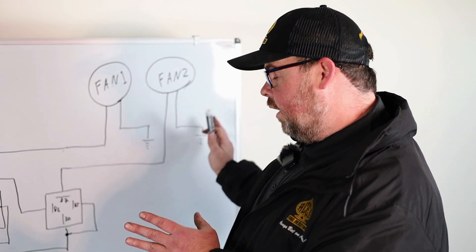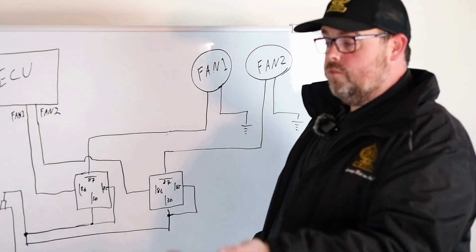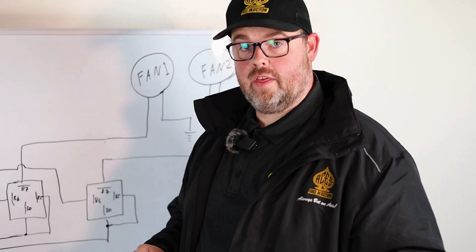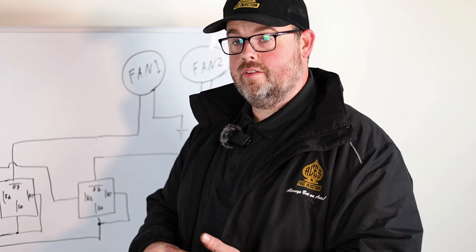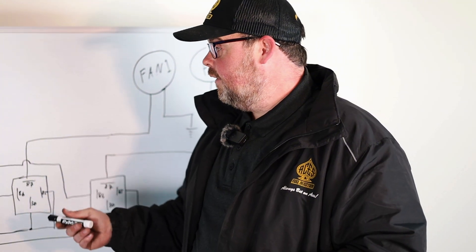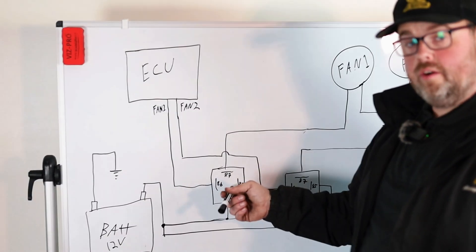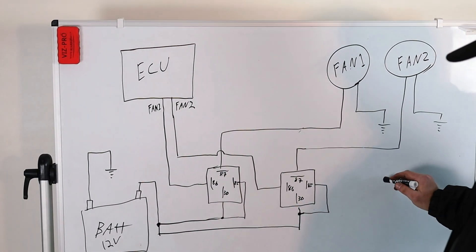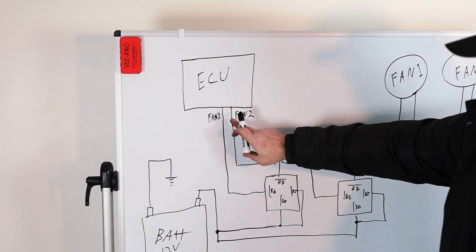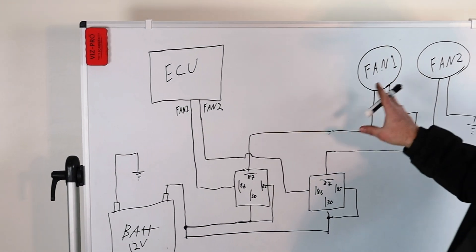That's a very basic way of doing it. If you were doing it with the wiring harness, you would literally be wiring a relay just like this, hooking up the fans, and making it run. When we get into the tuning and programming in the handheld, we'll go over everything in the fan settings and temperature settings. Same thing with the AC — it's going to be a different wire, that rev wire. When the rev wire has a signal going to it — because we had 12 volts coming in from the AC compressor coming on — it'll idle up a little bit and send a ground signal to your other relay for your other fan. You can send all three fans if you want, or tie the rev wire or AC trigger wire into fan one or fan two. If your AC comes on and you only have two fans, it's not going to hurt anything.